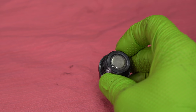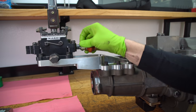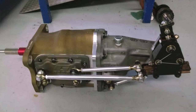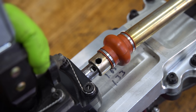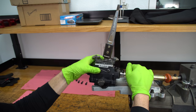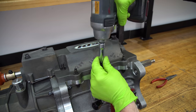This is what they call a top shifter style, so the shifter input and everything is on the top. On the older NASCAR transmissions, everything was on the side with levers and stuff — they were basically an evolution of an old Muncie transmission. But when they went to the Cars of Tomorrow, for safety they moved the driveshaft a little bit towards the center of the car, which gave them more impact protection on the left side, so they needed room and moved the shifting mechanism from the side of the transmission to the top.